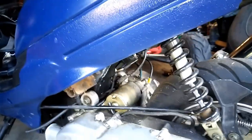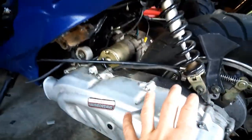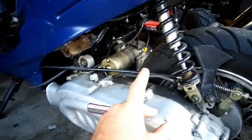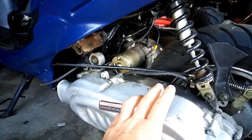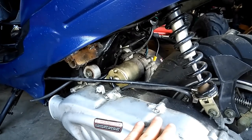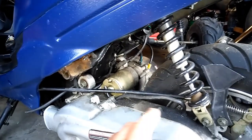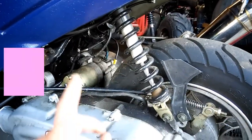I did that on both sides. You'll have to excuse these bubble gum welds — I ran out of gas in my welder and said screw it, I was already halfway through. Other than the two bolts, you've got six total wires: one for the starter, one ground strap, and then there are three different plugs that come out of the stator. Other than that you've just got your brake cable, throttle cable, and a fuel line.